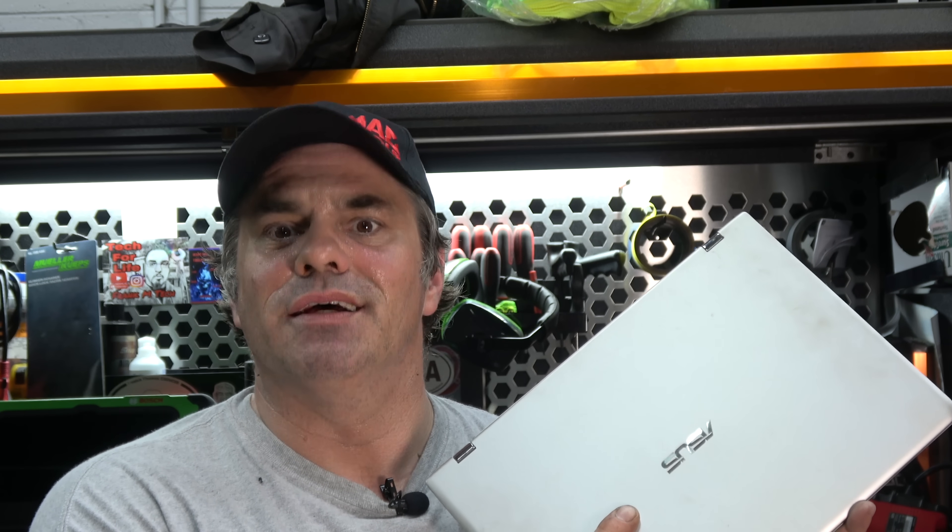You're going to need a Windows laptop — it has to be a Windows laptop. And you cannot use another browser other than Internet Explorer. There are a bunch of restrictions on compatibility between manufacturers that I'm not going to go into here. If you want to know that stuff, go see Keith Perkins at L1 Diagnostics and Programming — he has a class on J2534 on his Patreon. You need a Windows laptop; a desktop will work but it's a little more awkward. You need a really good internet connection, and you're going to need Windows Internet Explorer — not Edge, not Google Chrome. Internet Explorer. The only thing I use Internet Explorer for is flash programming.